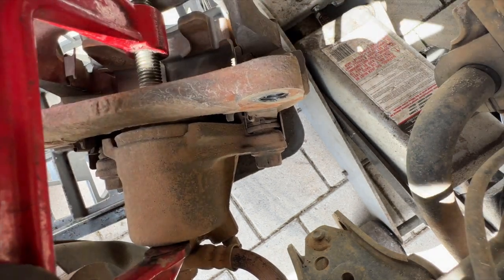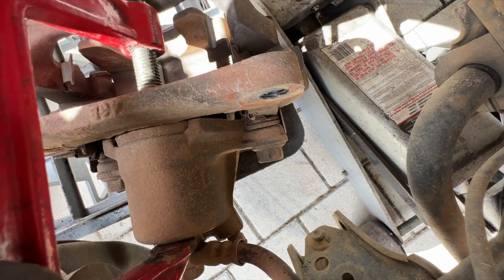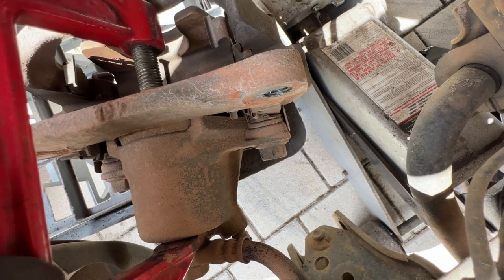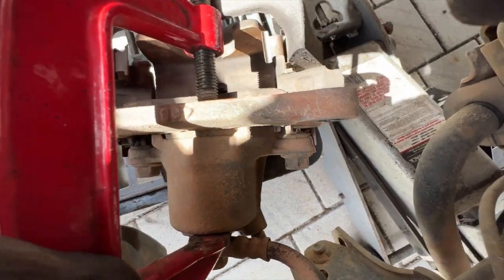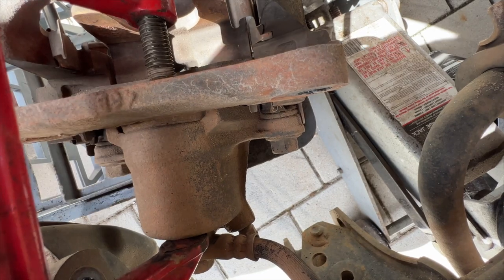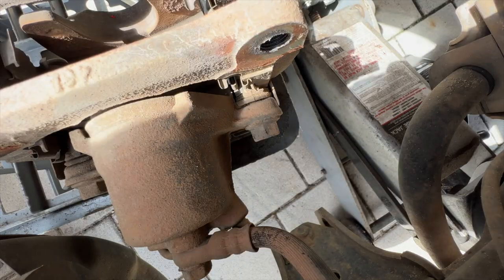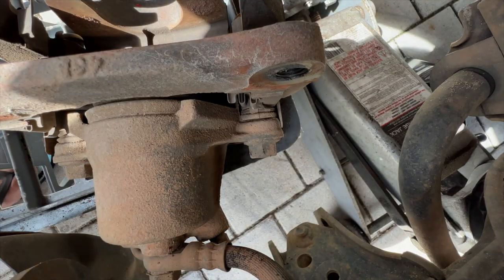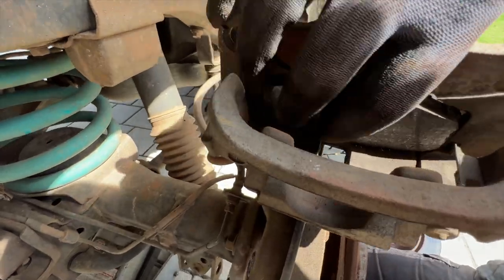I'm not actually clamped onto the brake pad here — I'm actually on the caliper itself because it's almost like the whole caliper moves. So I'm just winding that back and that seems to be working. You can see the brake pad's down here and I'm on this caliper, but it's pushed the piston back. It seems to have sent that piston all the way home, although I think there is a little bit more the piston can go in. With the amount of wear that was on there, it's going to have to go all the way home, otherwise we're not going to get them back on. That was a pain but I managed to get it most of the way.